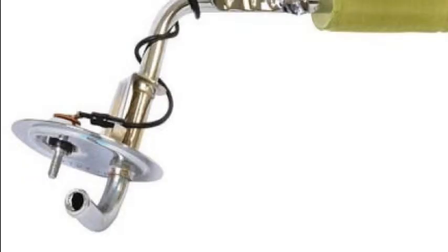On this 1967 Cougar, the fuel sending unit comes out of the tank and immediately takes a 90-degree turn straight up. Holley supplies a fuel pump with the kit, and that pump is a pusher, not a puller. It wants to be on the same level as the fuel tank. If you expect it to pull up and over, it will do it, but it will not do it well and it won't last long. We only had 20 pounds of fuel pressure because of this.